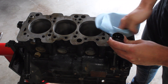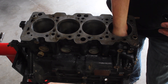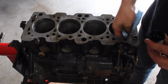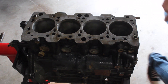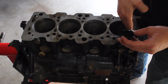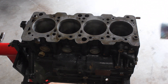The first thing I want to do is use some automatic transmission fluid to clean the cylinder walls out. I put a little bit in a cap and run it around the cylinder walls, using it kind of like a cleaner — ATF has certain detergents in it that help clean out the cylinder walls. Once it's cleaned out, I'm going to use STP oil treatment. It's very super slimy and sticky, so it'll be perfect for the cylinders when they first fire up. I'm just going to rub it all the way up and down the cylinder walls to get them all nice and lubricated so I can put the pistons in without a problem.